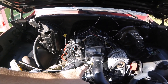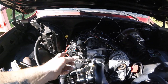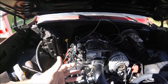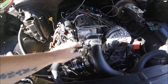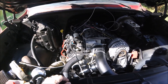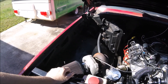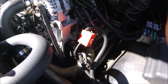This new IAT sensor actually reads about 8 to 10 degrees lower than the IAT sensor that was in the MAF sensor. I believe this one over the old one, because the old one was a $30 eBay MAF sensor that actually fell apart at one point — I had to super glue it back together. That also makes me wonder about all those times I was like 'damn, my intake air temp is through the roof.' I had built that whole custom cold air box setup — there's a video series on that — but now I'm starting to wonder if maybe my intake temps weren't as high as I thought and that MAF sensor just wasn't reading correctly.